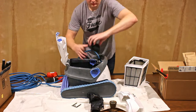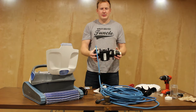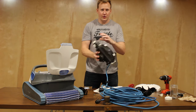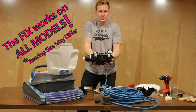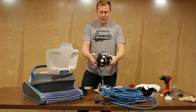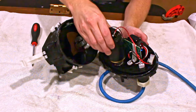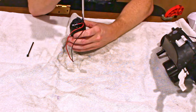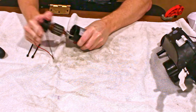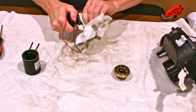I took the rest of the pieces out from the inside, which only required a screwdriver, and came to this — the black box inside every Dolphin. The shape might be more square on older models. They only sell this as one assembly and really don't want you to open it. Inside you'll find two electric motors and two circuit boards: one is the drive motor, the other is the impeller motor. I removed my seized motor and started taking it apart. It came apart pretty easily — two black machined bolts held it together and the rest came apart by hand.